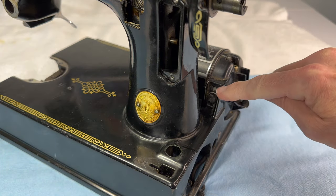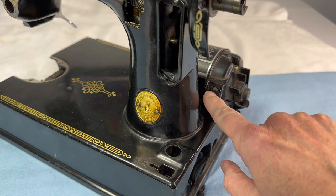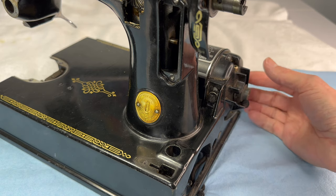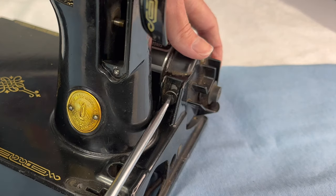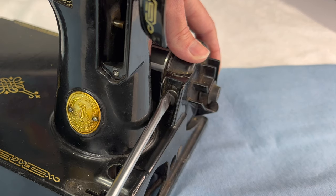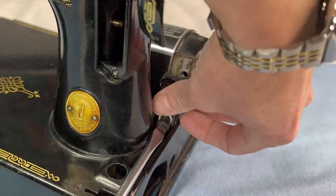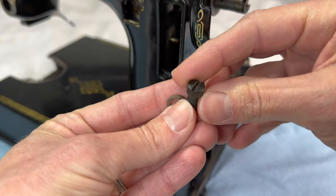This is the screw right here and you will probably have a screw with a washer behind it. That's what we want to remove, and when we do that the motor is going to kind of fall down, but it doesn't have very far to fall. You need a decent size screwdriver — it's left to loosen. This one was already loose. Just unscrew it and it will fall out. This is the screw and the washer. We can set those aside.